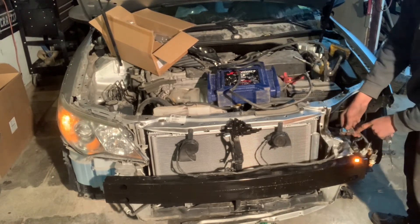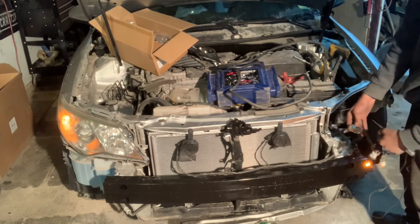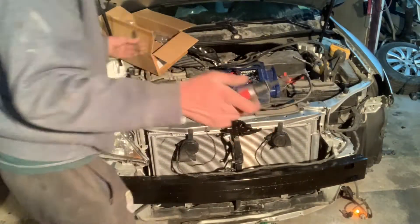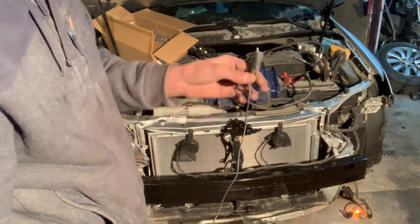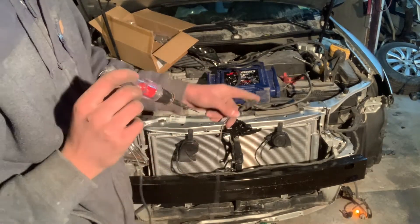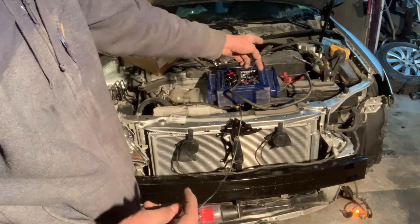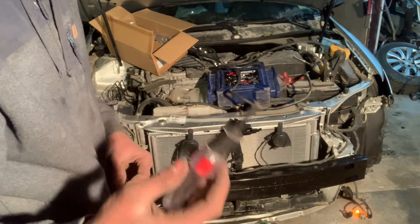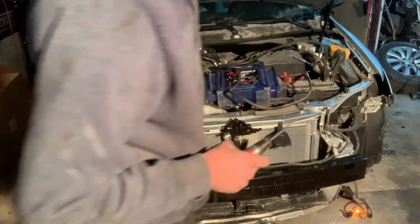If you want, you can easily just wire it up into the headlight one right here — it just has two wires. You just wire up into both of these; it doesn't matter which one is which as long as it's positive and negative, which it is. So I'm going to put this wire tester on the negative side of the battery or any ground on the car, then test which positive one I need to wire into. Then I can switch it to the positive terminal on the battery and find my negative wire — that's the only one I need to tap into.